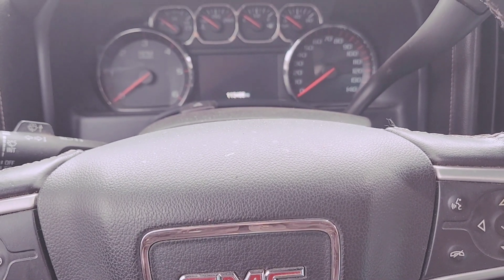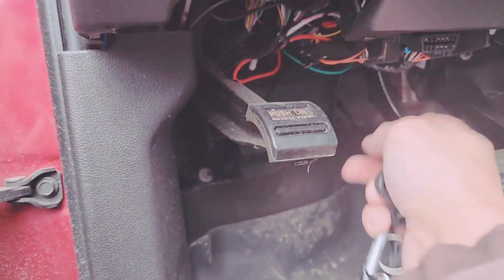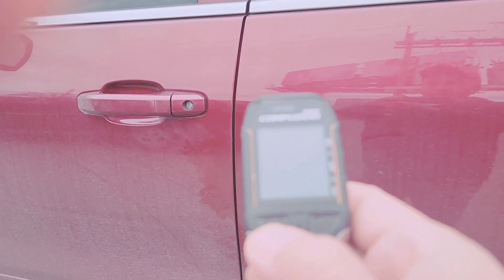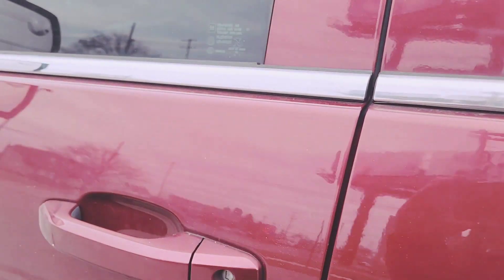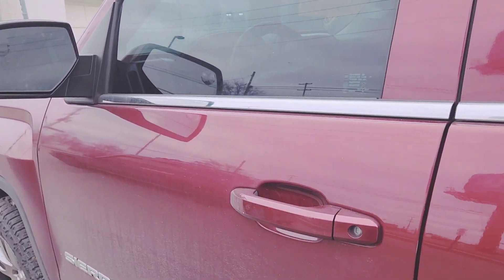Now I'm going to show you how the alarm will work. Usually on the alarm system, you're going to have the shock sensor somewhere on the bottom right there. Depending on what kind — I'll show you — it's usually right there by the brakes. The alarm does have a sensor. So I'm going to lock the door. A lot of people, once they lock the door, want to test the car. You can bang whatever — it's not going to do anything. What you want to do is wait 60 seconds for it to be completely functional. So I'm going to wait 60 seconds and then I'll show you.